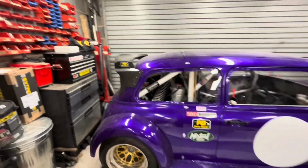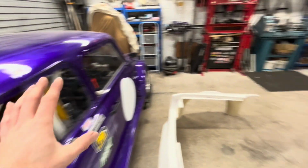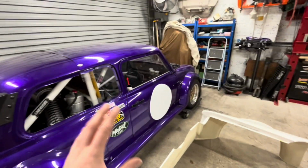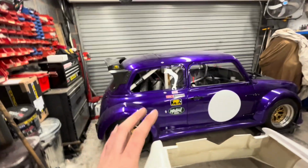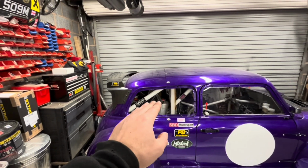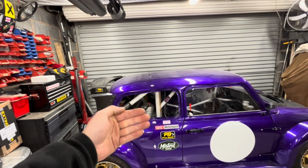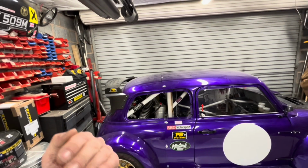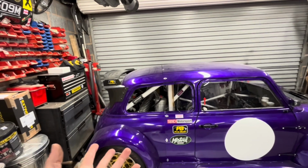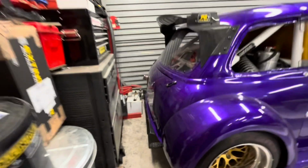Airbox, now that one I said we need to lighten. Oh, you can't see, can you? That one. Well, that went straight on and it actually fits really well. And the throttle bodies have got basically no movement, and because I've got no direct airflow pushing them off the back, because I had an issue before with the Blue Mini, the air hitting the air filter blew the throttle bodies off the back of the engine. Not the best idea. So that's pretty good. Diffuser's on.